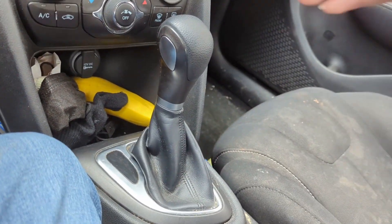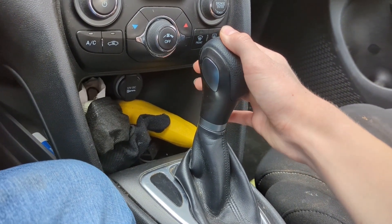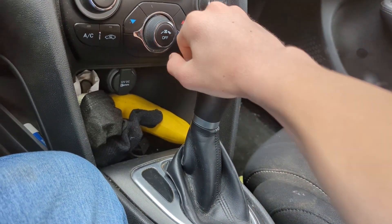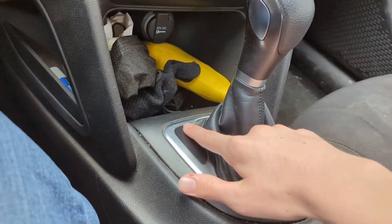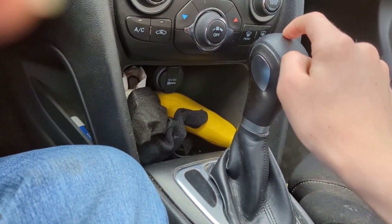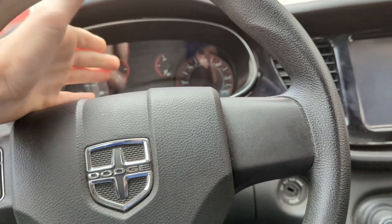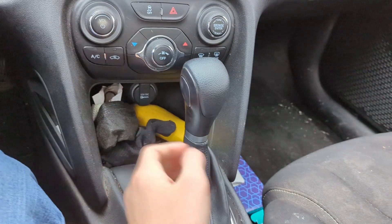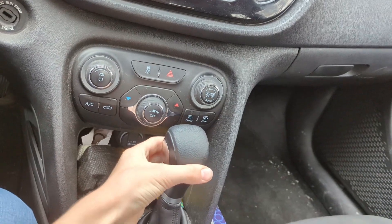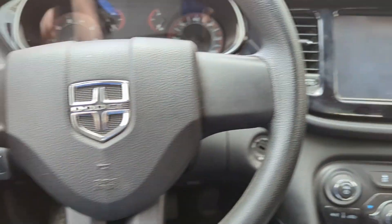This thing has quite a few mechanical issues. For the longest time we had transmission issues, but actually the transmission itself is fine — it's a brand new transmission. The problem is the shifter: when you go to shift into a different gear, it sometimes won't engage. For example, you'd shift into drive and the car would stay in park. It's not a major issue — once it's in gear, it drives fine. It's just sometimes on startup you'll have a little shifter trouble.